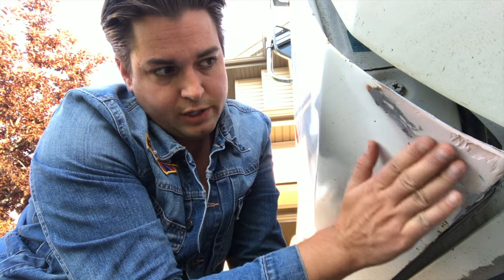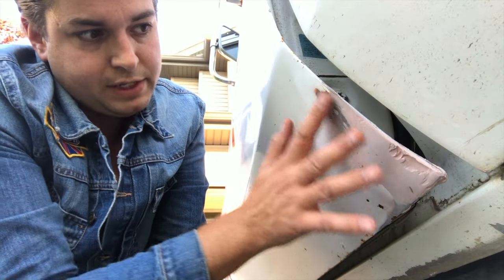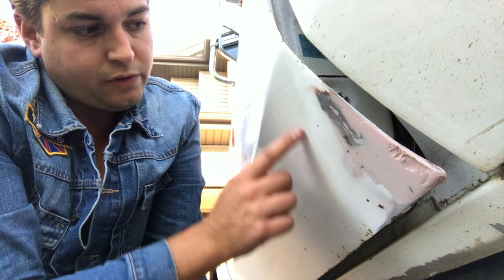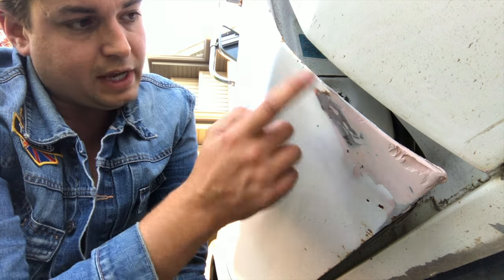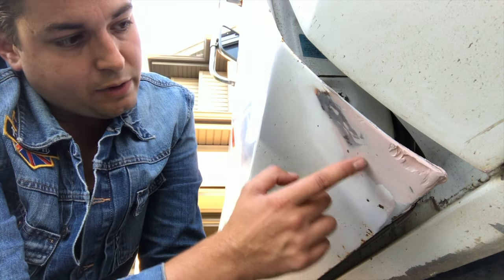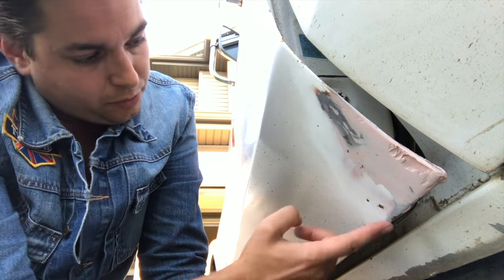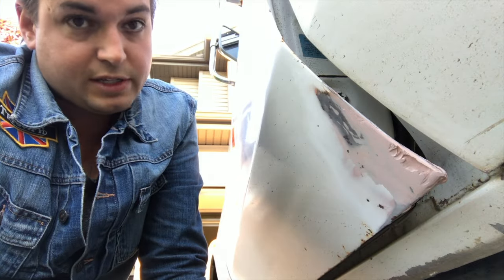The first pass is done and it's starting to smooth out. Clearly the spot where the hole was needs a little bit more filler, same as in here, but it's starting to smooth out nicely. You have to be careful not to jump over and get into your decent paint — you're working in a space just maybe an inch or two outside of where the hole is where you're going to have to prep and get ready to paint. So what starts as a little tiny hole ends up being about a seven-inch square that you have to repair to make it blend and look good. I'm going to catch a couple of these little rough spots in this area while I'm here, and then we're going to get some more filler in there.